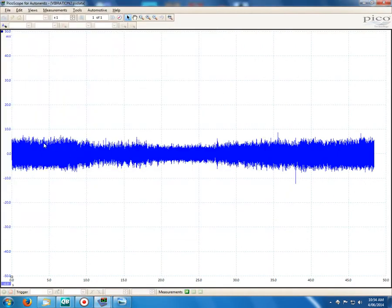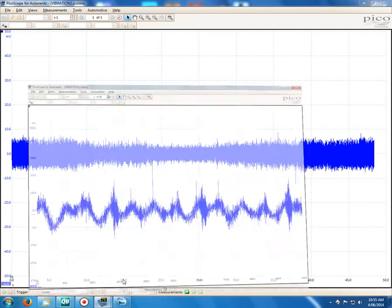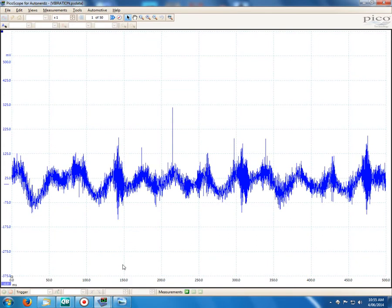And this sort of proved that that wasn't an internal problem. By jacking the engine up, we're able to reduce the vibration greatly. So it suggested that our problem was to do with the mounting. So my next step was, I figured, since it happened, according to the customer, after the timing belt, I thought I'll attach this piezo sensor to an engine hook. So I grabbed an engine hook on the top of the head and clipped the piezo to that.